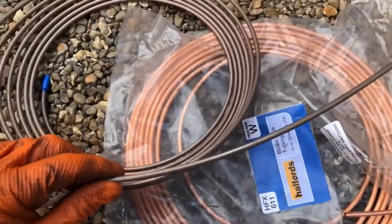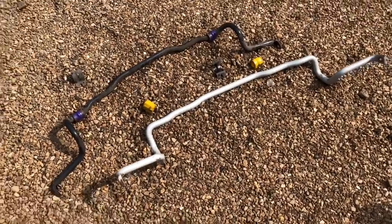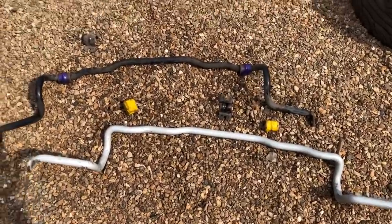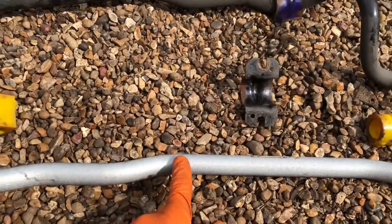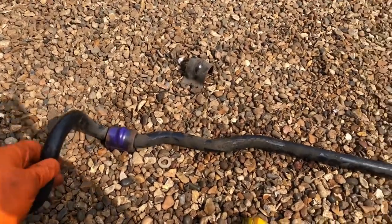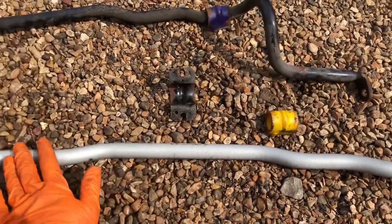This is the roll bar we're going to be using. The front one at the minute is a stock roll bar — I left it on there because it was soft, I didn't have the rear stiffness I wanted. If you put a stiffer roll bar on the front without the rear stiffness to match you're going to have understeer. So now I'm stiffening up the rear I'm going to put on this Whiteline front anti-roll bar. The stock one you can see was poly bushed but it's 20mm — the Whiteline ones are 23mm. The bigger difference though is that production car roll bars are hollow — it's lighter and saves material, but not as strong. The Whiteline roll bars and any aftermarket ones like H&R, Eibach — they're all going to be solid.